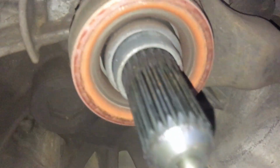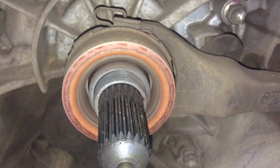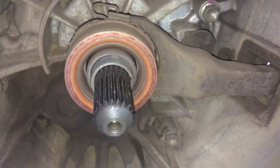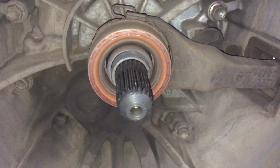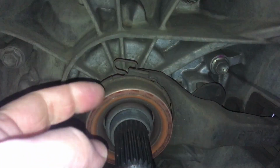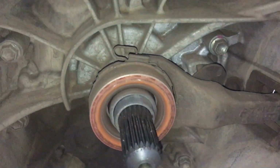But with these, they're all alloy, and we'll show you more once we get this off. When it comes off, that alloy there can wear down. It can get quite damaged from mud, dirt and debris. And we've actually got someone just recently, like I said, quite timely, he's going to do a kit that re-sleeves these gearboxes with an oversized bearing to suit.